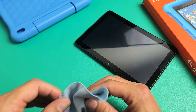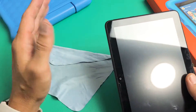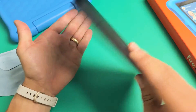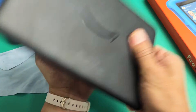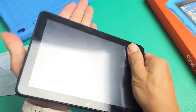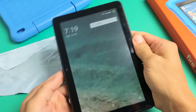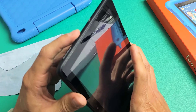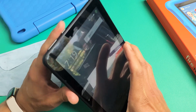The next possible solution is what I call the smack method — because we're going to smack the tablet. Go ahead and put your palm out. You can put something on there if you don't want to smudge up the screen. We'll smack the screen side and the back. Hold your palm out and give it a smack. Check if it turned on. Give it a couple of whacks on the bottom as well. Do the same on the back. If it's still a black screen, no problem — press and hold the power button for 15 seconds until it totally turns off, then press and hold again to turn it back on, and hopefully you now have a working screen. If not, we're going to go to the next possible solution.